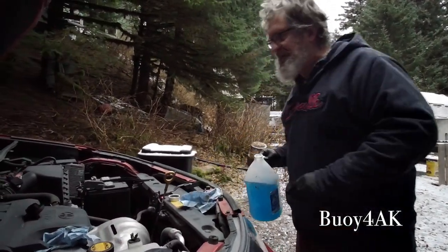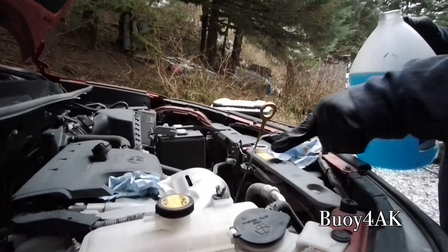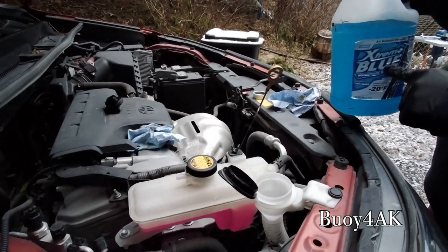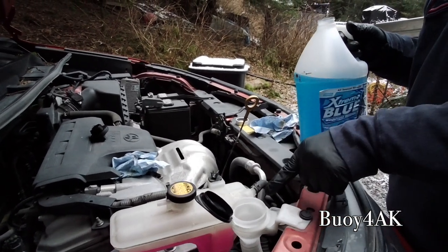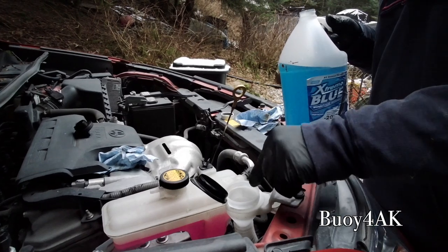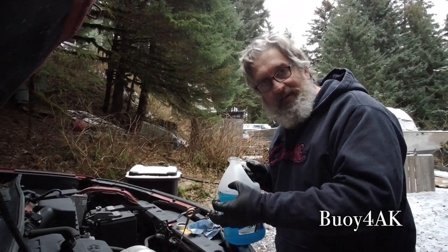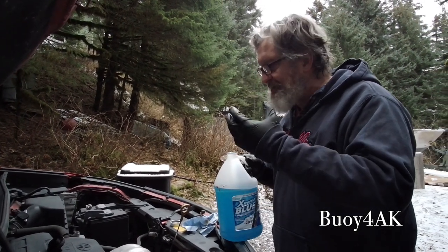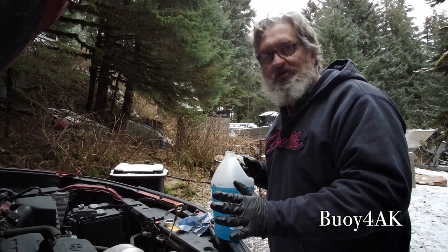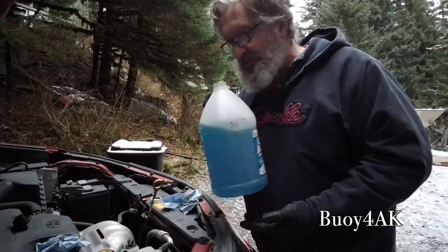And while I'm waiting for the oil to drain, it's important to maintain patience and to be efficient. So in the meantime, now, antifreeze, washer fluid. Many modern vehicles, these are right next to each other. If you put antifreeze in the washer tank, it's bad for the environment and animals and that kind of stuff, but you're not going to damage the vehicle. If you put washer fluid in the antifreeze, it's going to cause that antifreeze to coagulate. It's going to turn it into jelly. And you could overheat your engine. You could damage your water pump, your hoses, your heater core, which is inside the dashboard. There's all kinds of things that could go wrong if you pour this in the antifreeze. So pay attention. Pay attention. That's what I always tell the 12-year-old.